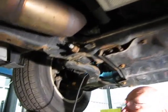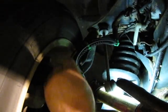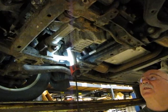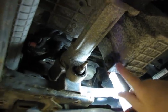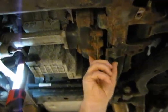Also, while we're up here, here's where the front height sensors are for the air suspension. And while we're up in there, you can see there are brake lines and stuff that go to the front brake caliper. As you can see, I've removed the skid plate. You can find your drain plug for the engine oil right there. And if you move towards the front, the oil filter is right here — it's attached to an oil cooler. While we're up here in the front, I can show you where the front differential is. It's right here with its drain.